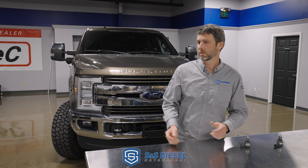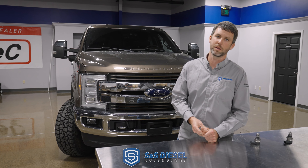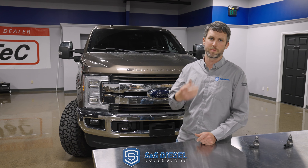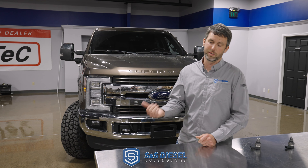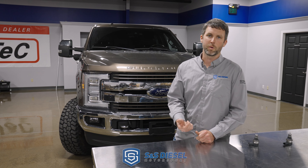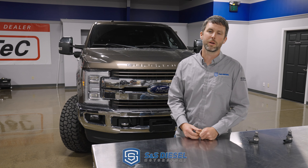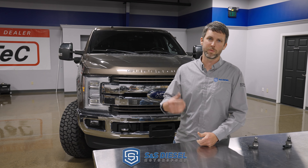So it's back together — Ian and Ryan got it all buttoned up today. We actually left the aftermarket lift pump on it and put different filters on it, one with a drain on the bottom of the water separator. We're just going to periodically check that to see if we're still circulating and picking up more water, and then the owner can continue to make sure he's not getting more water in, just in case it's getting water from rain, splash, something like that. We don't think that's the case — we think it was just picked up at a pump at a station — but you never really know where it's coming from when you get stuff in the fuel.